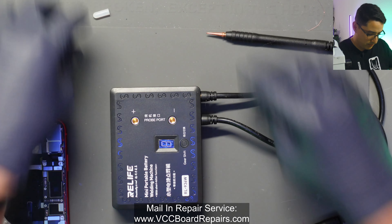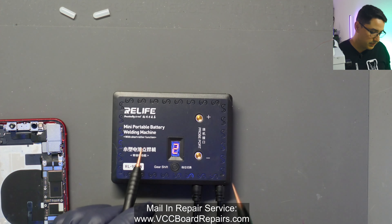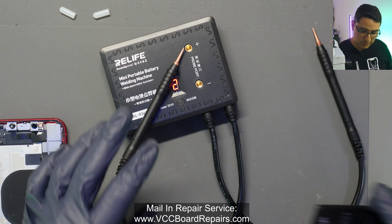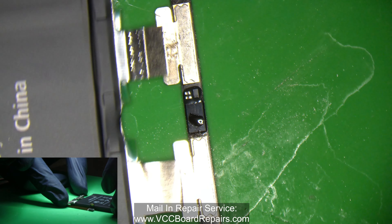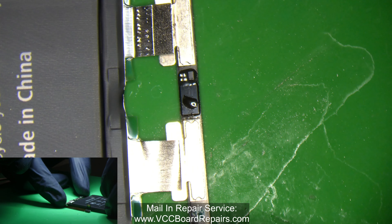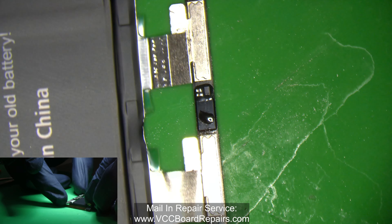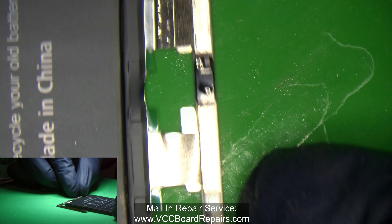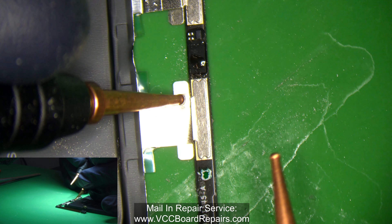Take off the little covers. We're going to put it at level two. The way this works is you touch one side, then touch the other, and that creates an arc and spot welds. I highly recommend doing this under the microscope because you can see way better. They do sell jigs for this, although you should be able to do it without. Let's do it just like they did on the original, putting it over and holding down. It doesn't matter which one goes where — you're just going to press one to tack it down.